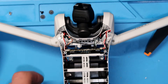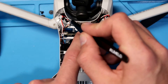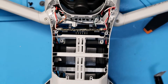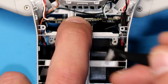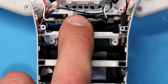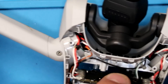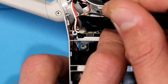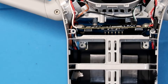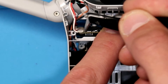You're going to have to be skilled with the soldering iron to do this because you're working in between plastic. But you provide yourself ample room to get in there. Before, the ESC sits flush with this board, and it is impossible to actually get in there and solder without burning your frame. What we did was create separation — you push it down from the top, and that provides you with enough room to actually get in there, remove your wire, solder, and do what you have to do. Keep in mind, there is actually glue covering all these solder joints, so you're going to want to take a hot air station, heat that glue up, peel it off, and then you can go ahead and solder.